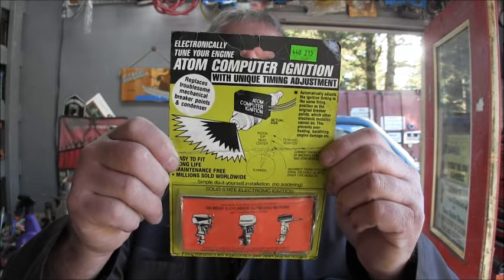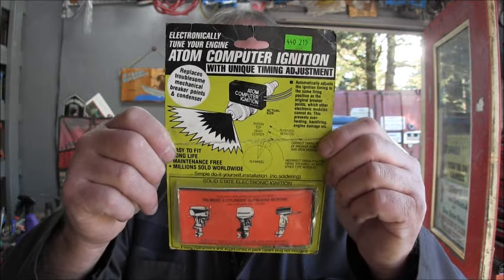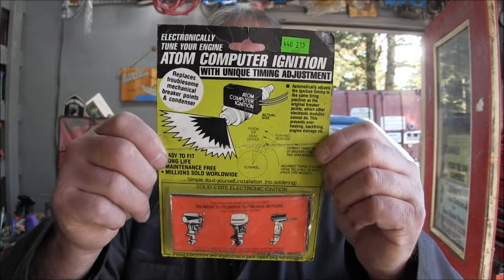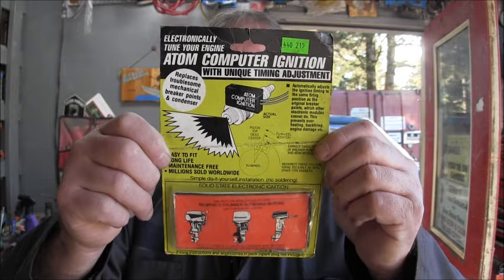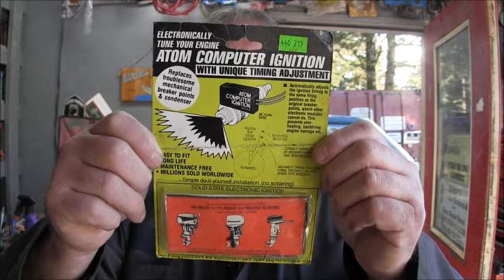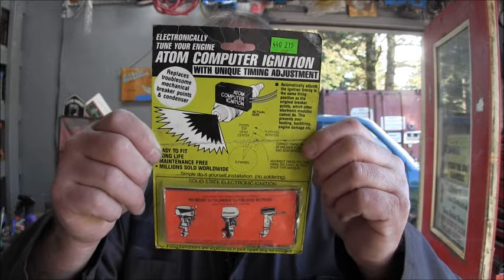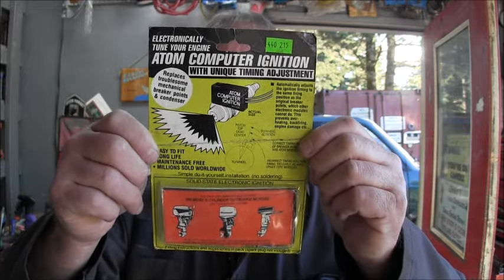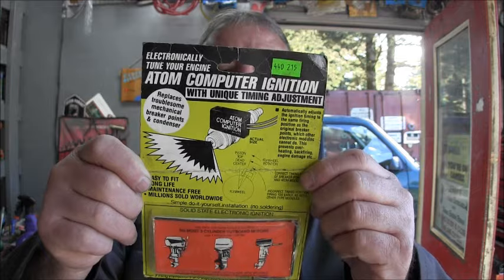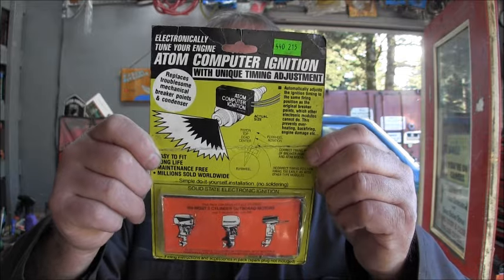Fits two-cylinder outboard motors using one module per cylinder. Not for engines with battery-generated flywheels. Says it will also work on a single-cylinder outboard with throttle-connected ignition timing. For outboards with fixed ignition timing, refer to Module 7. Module 7, purple, fits outboard motors with fixed ignition timing.